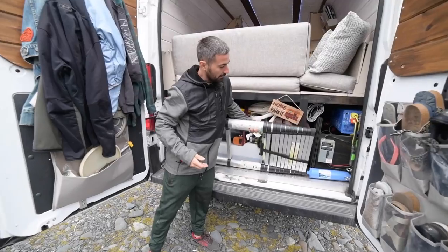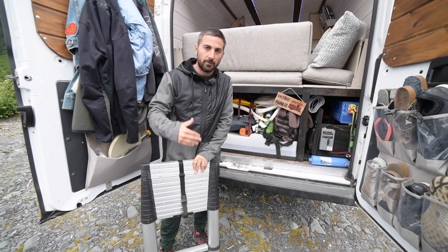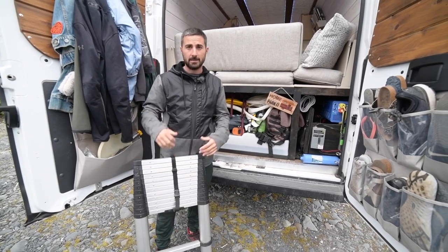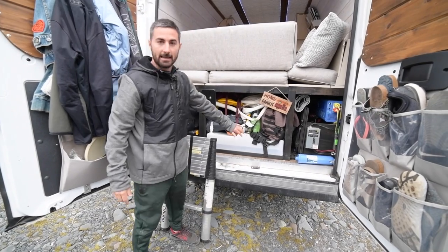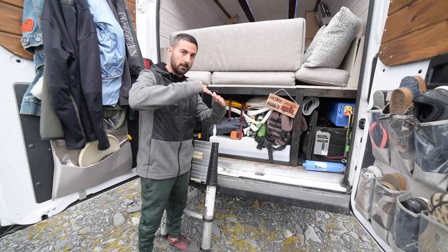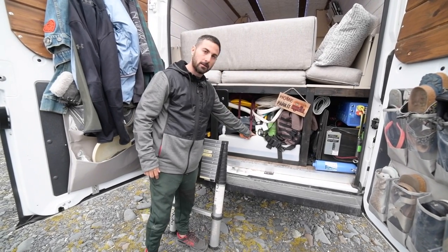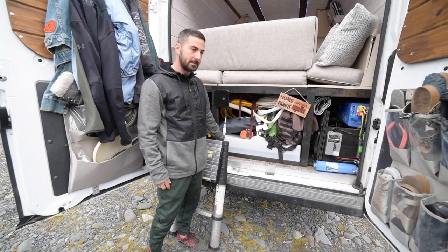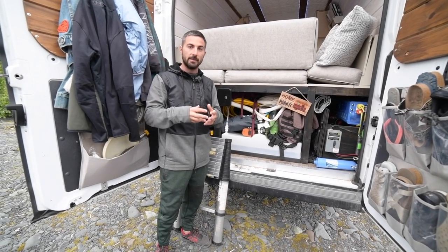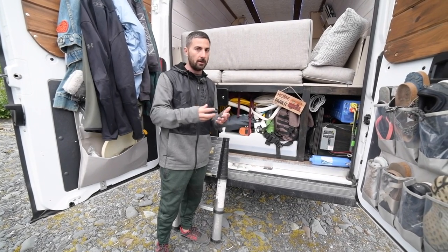We have this awesome little telescoping ladder right here, which lets us get up to our roof deck and also be able to clean off the solar panels — something you'll have to do to keep pulling in as much power as possible. This is that 40-gallon fresh water tank; it's a nice flat tank. I put it on a slight incline so it always pushes water to the front, and I plumbed everything from the top down. We have our fill coming in from the top, our air bleeder coming in from the top, and even the line going to the pump comes from the top down. What that does is relieve pressure from water pushing on the tank, so you don't have to worry about leaks happening.